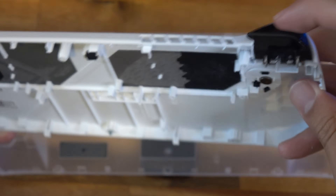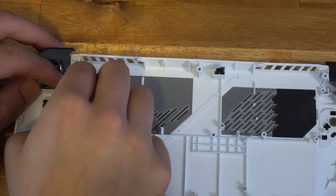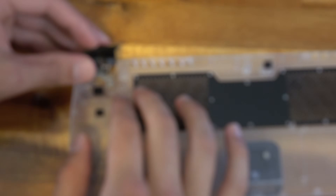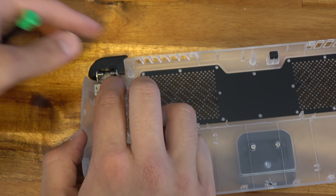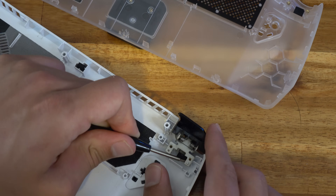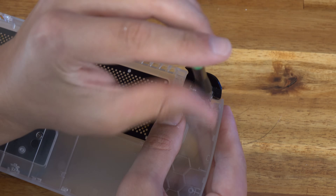First off, we need to cannibalize our triggers and paddle buttons for our new back plate. The trigger assembly is just one piece held in by two screws. Take those two screws out — the triggers themselves are held on by little plastic pegs, so just use a screwdriver to pop it off those pegs and the whole trigger comes out. For reattaching the triggers, I found it easiest to push down the trigger before you place it onto the pegs. This ensures that the little latch on the trigger will be pressed down and providing tension to the spring. Then tighten those two screws back into place and give your trigger a test to make sure it feels correct.